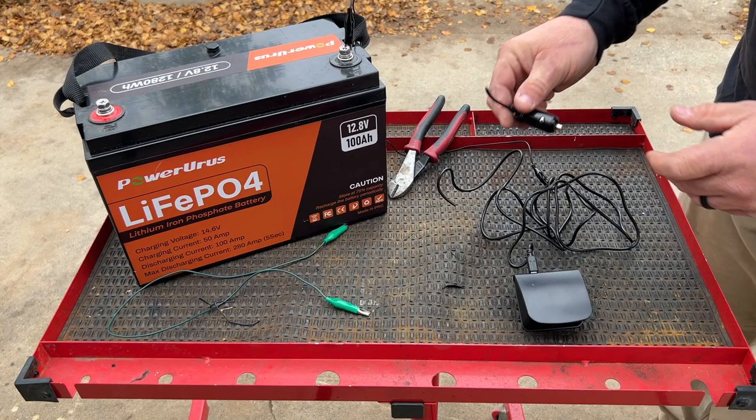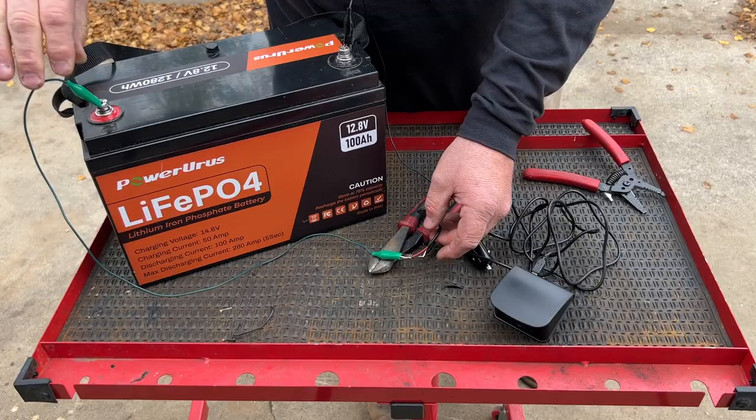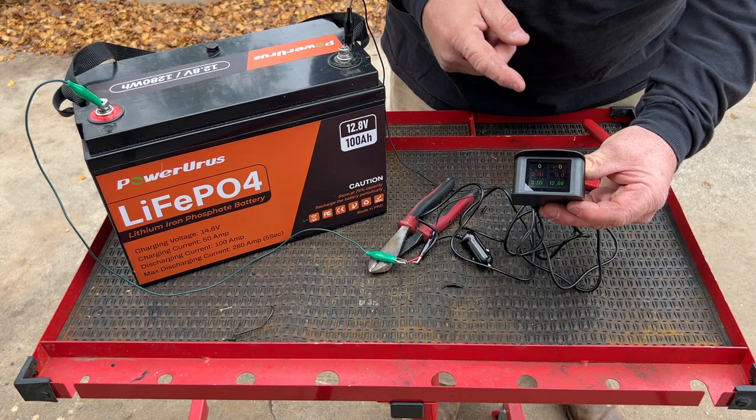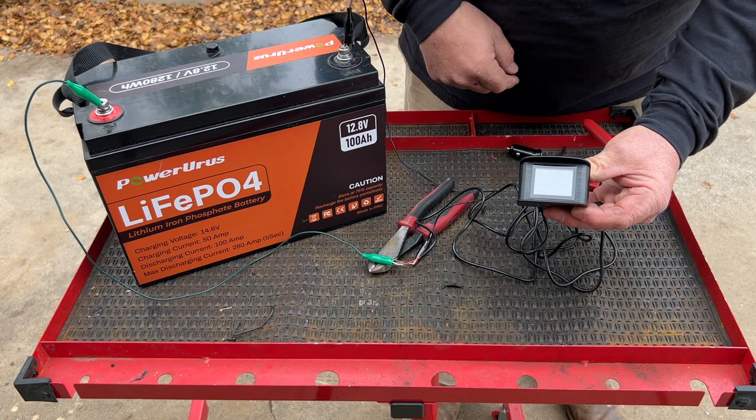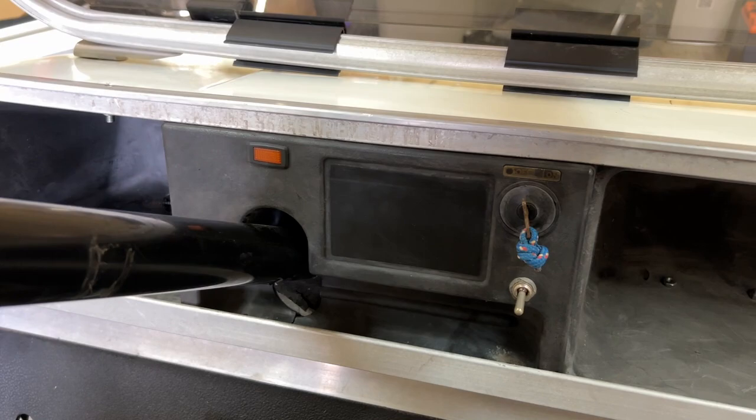Really and truly it's just a red and black wire. I stripped it back and it's just red and black, so I'm going to strip these back and run them to the battery. That works. So if you cut this cigarette lighter end off, 12 volts feeds this — it would be perfect for our application. I'm going to go ahead and see where we're going to mount it on the golf cart and get it in place.